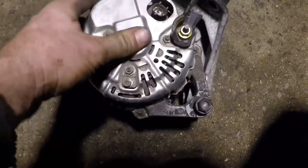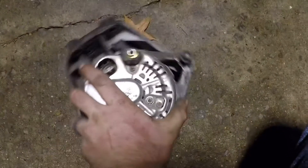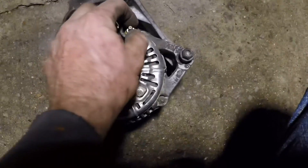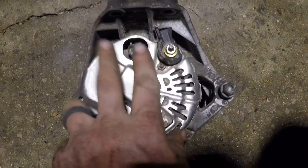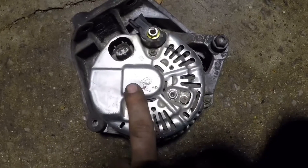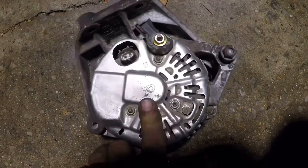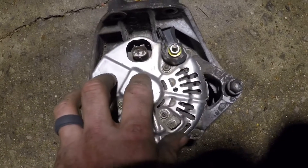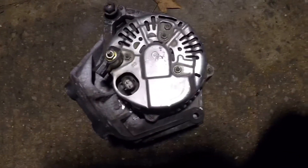This is a 1999 136 amp Dodge Durango alternator and it looks like it's gonna fit in the Cherokee. This is a 99 Cherokee - I think 99, 2000, 2001 have this plug and single post terminal. Before that I think they had a different style with two or three wires, and this is just far easier, so I got one that matched my Jeep. I got this alternator for $25 at the pick-and-pull, or $21 with a core. I took it to my local shop and they put new brushes on it, cleaned it, greased the bearing - all that good stuff - for $25.